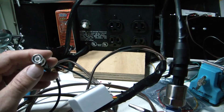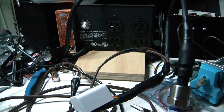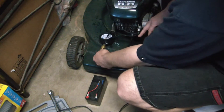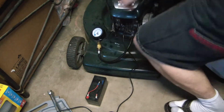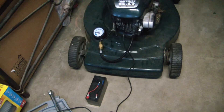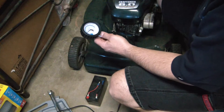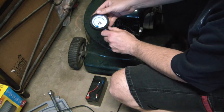I don't want to disassemble the car, so I'm going to use the lawn mower just to give you a quick example of how this works. I've got my pressure gauge hooked up on it right now. Running it real quick — we'll compare this later to what we get with the sensor setup — but right now we have right around 70 to 71 pounds of compression in here.